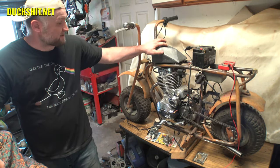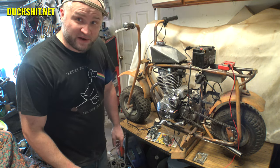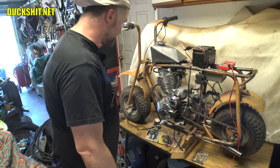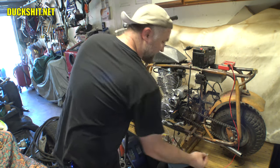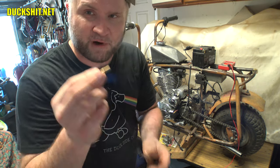We're back today with the Doodle Bastard, and it's been quite a while since I've worked on this thing — in fact, about a year. I've fiddled with it a little bit in between, but nothing that was video worthy. Where I left off is I got some new pilot jets, because it turned out the thing wasn't idling right due to a fuel mixture problem.